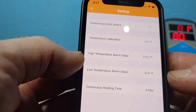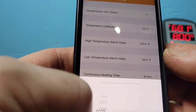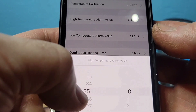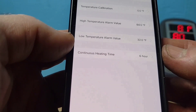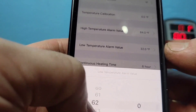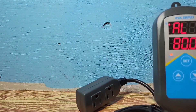Next is the alarm value — what temperature triggers an alarm. It comes preset with the maximum the controller can handle, which is way too high for an aquarium. Scroll down past 212°F. Like we set with the buttons earlier, I'll set the high alarm to 84°F. I also want a low temperature alarm, so I'll set that to 74°F. Click Complete.